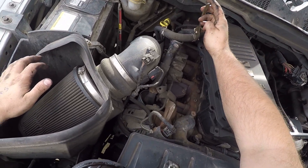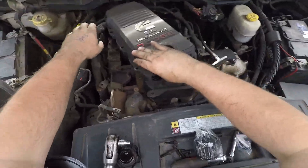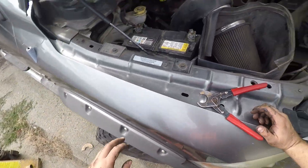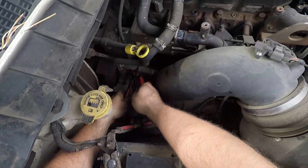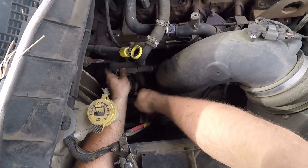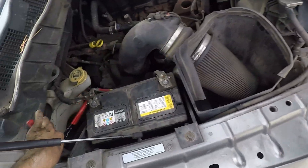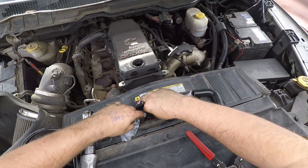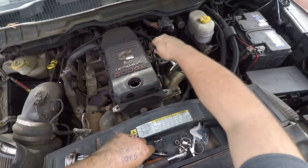Next I took the opportunity to remove that hose clamp, since this section is replaced by the kit. This is a basic kit — pretty much every cheap one on Amazon is very similar if not identical. Here I'm cutting the hose that comes out of my cold air intake — that's the hose where the oil breather shoots oily air back into the intake, which now won't be re-entering my engine because it's venting to atmosphere. I chuck that piece aside and don't worry, the kit does take care of that half-open hose. Here I'm installing the 8mm bolts back together.